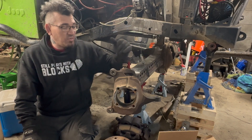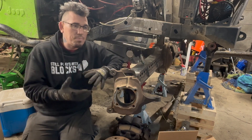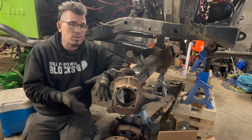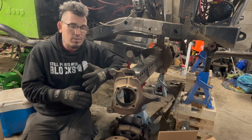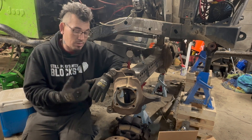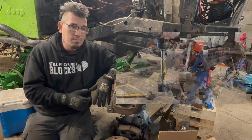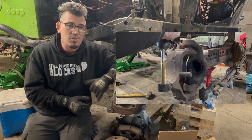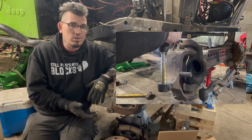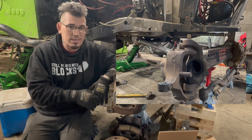The first thing I got to do to get these on is drill out the knuckle. A lot of people talk about stepping up drill bit sizes, and that works great. But what I found works really well is just to throw the three-quarters of an inch drill bit in, put it on high speed on a cordless drill, put some cutting oil or WD-40 in the knuckle, and just run it home.